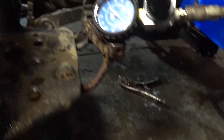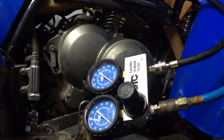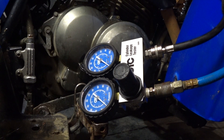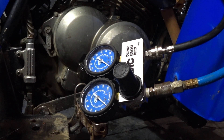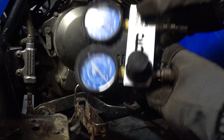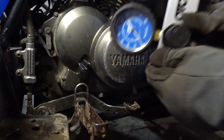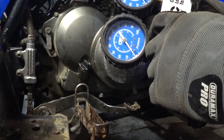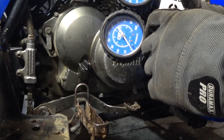Just in case we're on valve lap — meaning on the other stroke, both valves are slightly open. If you can pull the valve covers off, you can actually hit the rocker arms; if they move and they're not tight, that means both valves are closed. But in this case we don't have that access. I think we were right — it's a valve problem.